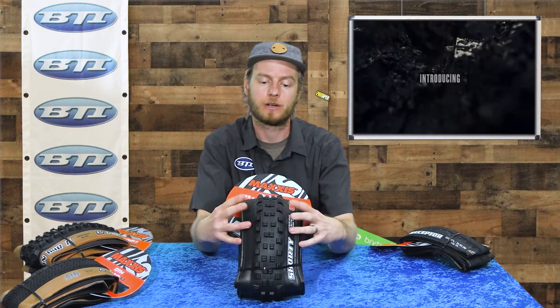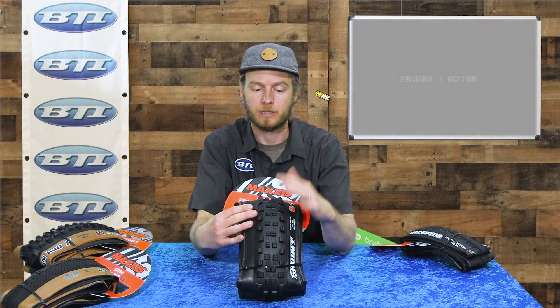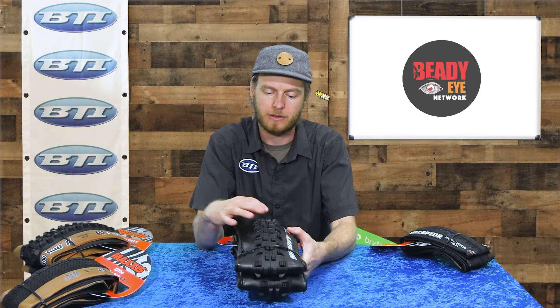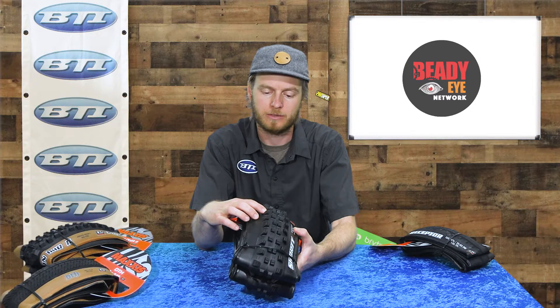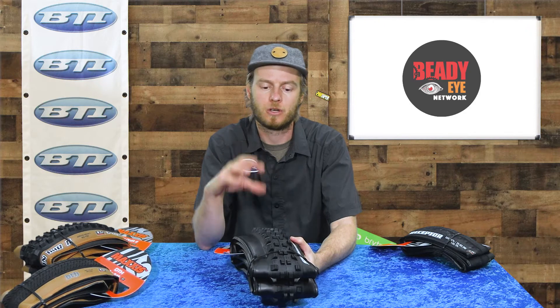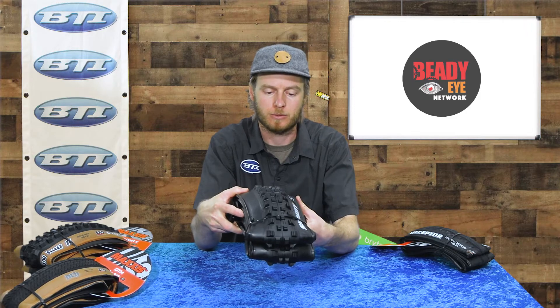Compared to the old version, it's now in a 2.4 width as opposed to 2.5 — kind of a minor difference, but it does mean the tire is a little more square, really offering the best grip for those corner knobs especially. They also added a small detail between the side knobs and every other group of center knobs — just little raised bumps, less than a millimeter tall. The idea is that's gonna break up some of the mud and allow it to shed slightly better. There's also a little different construction on the side knobs — a whole bunch of details were updated to perfect it for increased grip and better all-around use.